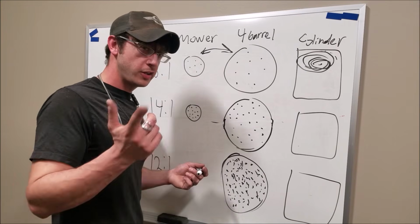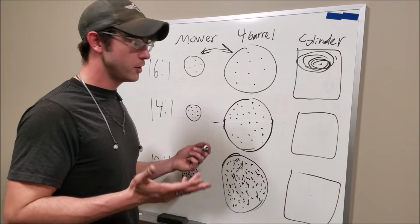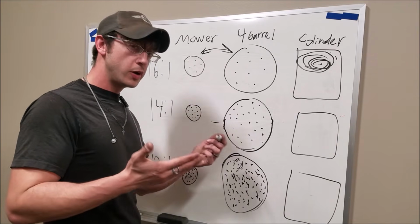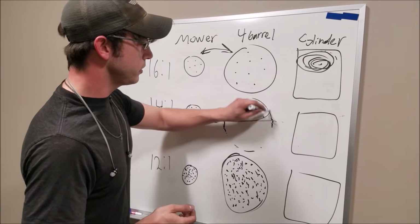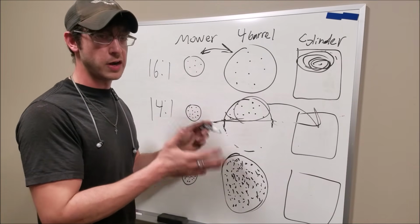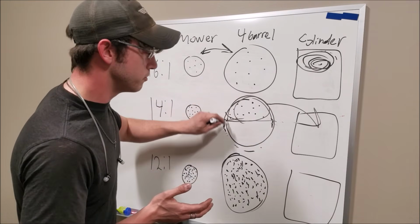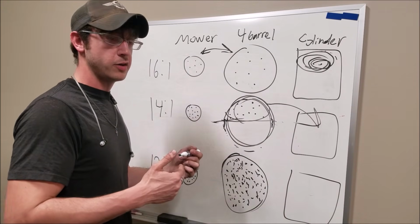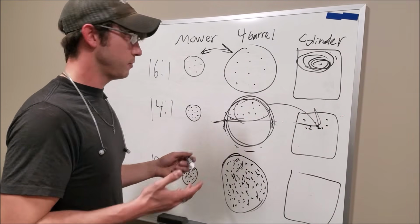Now to make this relatable, just think of your vacuum advance on your distributor. It's adding timing at high vacuum scenarios. When are you at high vacuum scenarios? Well, when you're at very light throttle, not a lot of throttle. What have you done? You've essentially taken the cylinder charge, cut it in half, so the volume that you're getting in the cylinder is essentially less. And because of that, you need to fire your mixture sooner. And that's why when you roll into the throttle hard, and you're again getting more of this volume into the engine, then vacuum advance drops out. You pull timing in order to still fire that mixture at the right time, if that makes any sense.